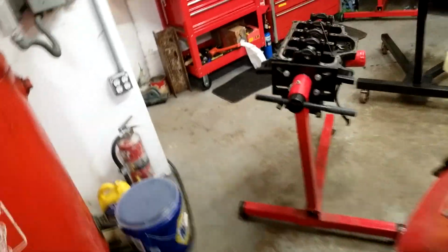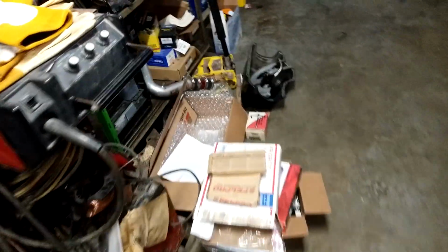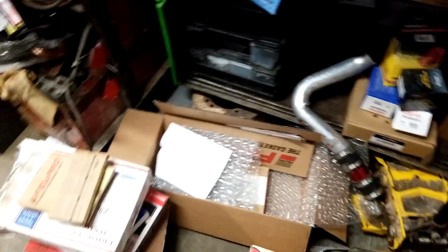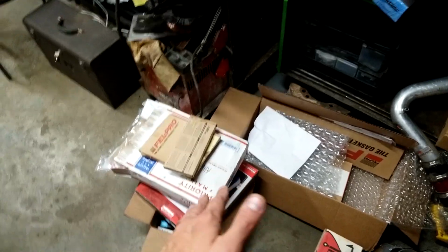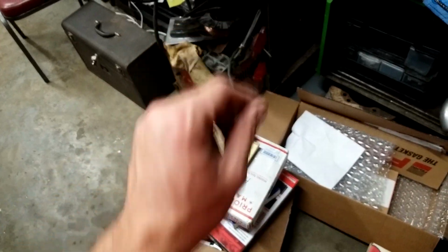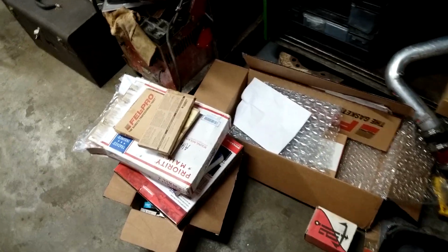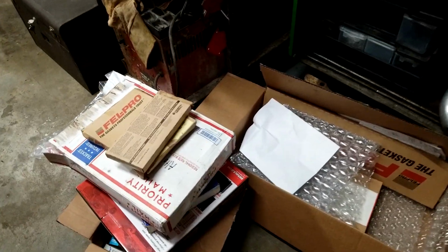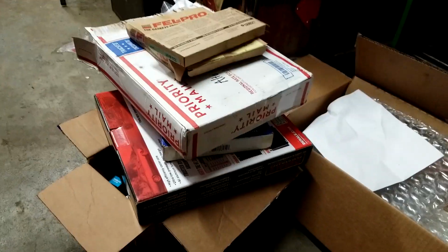So hopefully I can find one of those, send that thing to the moon, because I'm going to try to put my own shift kit in it. I have a shift kit in here somewhere. I have Alto green clutches, which are one up from the factory stuff, so not amazing race stuff, but they're pretty heavy duty. Hopefully it'll live up to this. I'm not going to run this on like 30 pounds of boost or nothing. Not that it would make any power at that level anyway. The head doesn't flow enough.